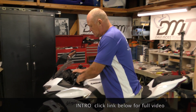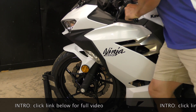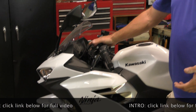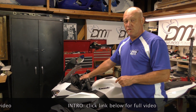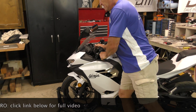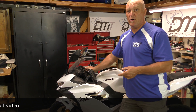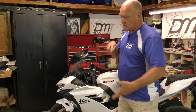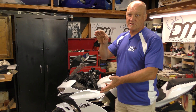So if we look at low speed damping — just gently pushing the fork — it comes back and the oil is brand new. So the oil choice for the bike on the showroom floor, especially for a lighter rider, is fantastic. If we hit a big bump, then we are going to get the anticipated pogo, just because of the velocity and then the release, and it's going to settle itself down.